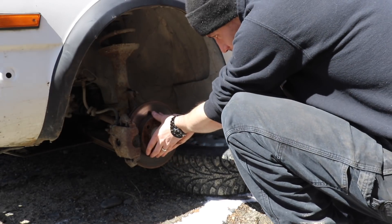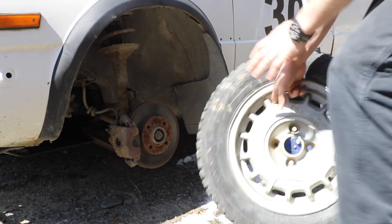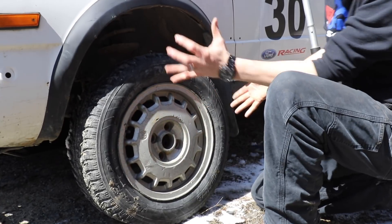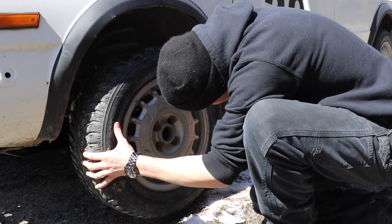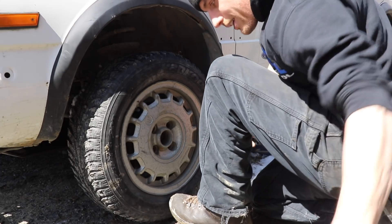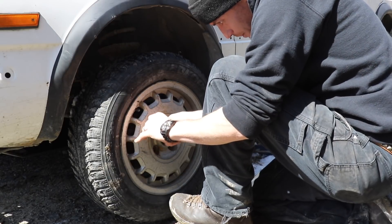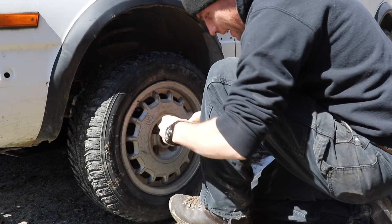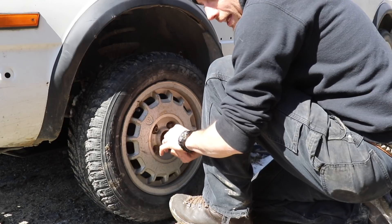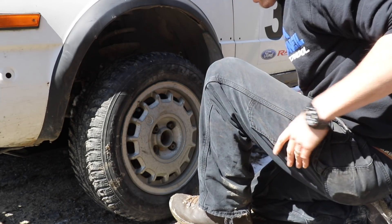So in order to put this wheel back on, I've got to make sure that the brake disc is aligned with the hub and everything. Grab my wheel. And now I need to align that with those slots without rotating the brake disc on the hub. Get the hub-centric piece on, get that together, hold that with your foot, get these started. You always want to either start these by hand or put them in the socket, get that lined up. Got one in — once you get one in, you will get the rest. Just start each one for a second by hand, and then you can hit them with the impact. Always keep yourself in a place where if this car shifts right now, you're going to be safe.